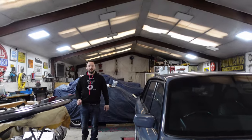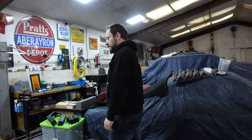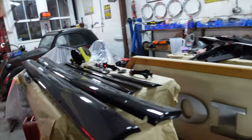Because we haven't done the adjustments on any of the suspension components to get the prop back in. We need to make sure that the diff flange is 90 degrees. That's why you get adjustable torque rod, so you can get that angle correct. We don't want prop judder, do we? No, you do not want judder, and that's the whole point. If you're lowering the car, you have to adjust the rear geometry. You have to. More gathering parts. Dust.